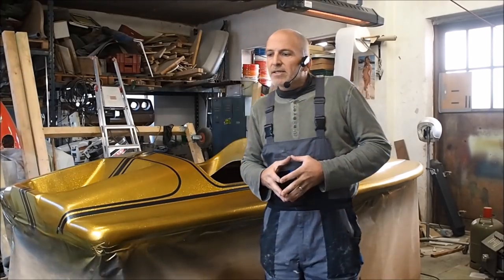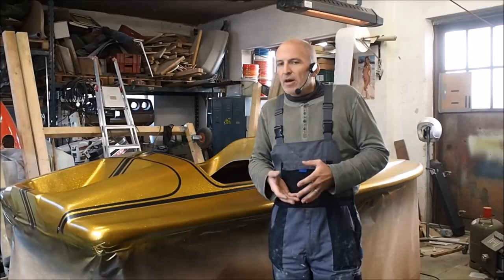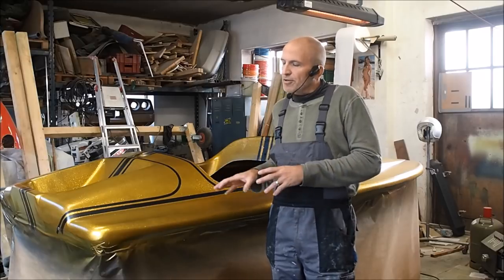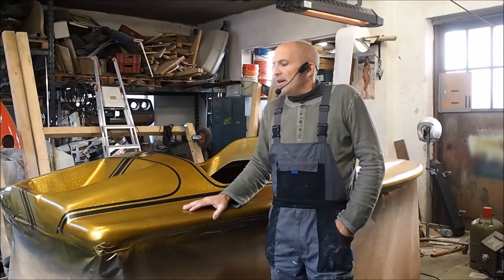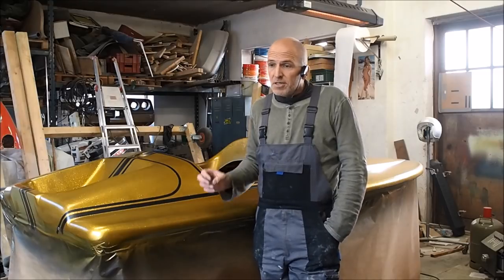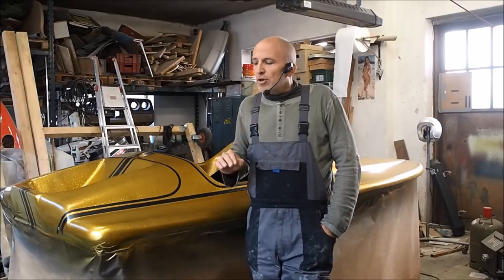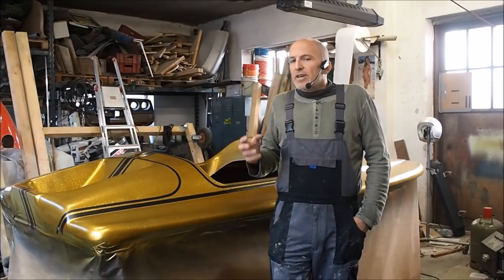Another important thing is that I do not mix the flakes into clear coat, because clear coat takes a while to dry and builds up pretty high. So I use clear binder, which means I have less build-up. It's much more sticky, and basically I just want those flakes to stick to the surface - I don't want to build up big layers. This is three coats of binder with flakes. Now it will get three coats of thick clear coat with no thinner, so I want it as thick as possible. After that it's going to get sanded flat - until it's completely dull again, all the high spots have to be gone so you don't see any low spots anymore. Then it gets another two layers of UV protective clear coat on top.